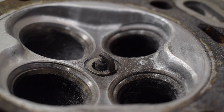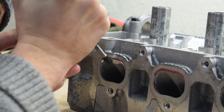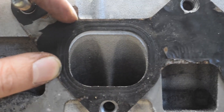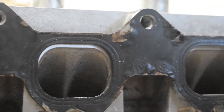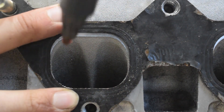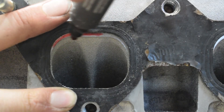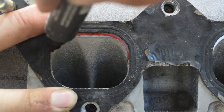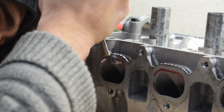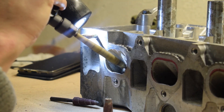Now we're getting back to porting and focusing on the intake ports. There will be no extreme porting here, but I will definitely be gasket matching, because as you can see, there's a pretty massive mismatch between the intake gasket and the port. This hurts performance, and matching in a case like this can even help a bone stock engine, as this is a relatively significant obstacle in the path of the incoming air. The carbide burr removes the excess metal, and the cartridge rolls smooth and blend the surfaces into one.